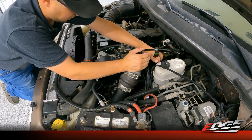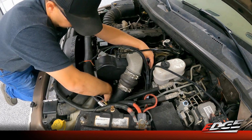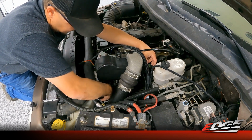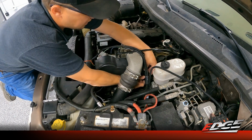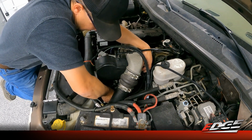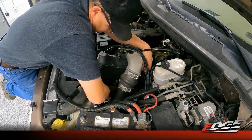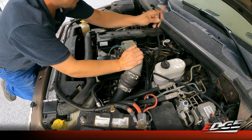On these trucks, it's actually located in a couple different spots. On this particular 01, our data link is up on the front of the engine, right below the injection pump. You'll see the 3-prong connector. And this is an open connector. They usually just have a dummy plug cap on the end to keep moisture and such out. So we can go ahead and connect to this data link very first. And it's just a simple plug and play. Obviously there's a keeper on it. Make sure that gets plugged in and clicked. And then we've got our map sensor here.